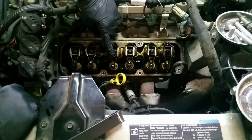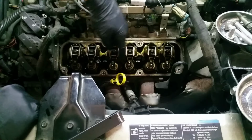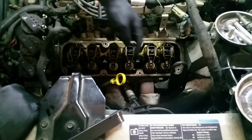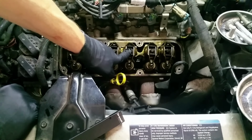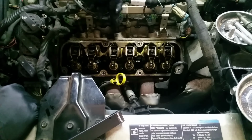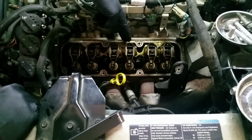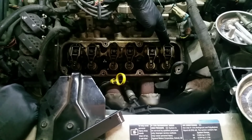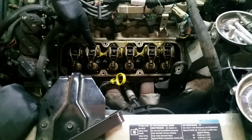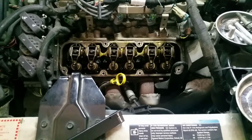The other thing is, I know this is the exhaust side because the exhaust manifold is right here, and it's in line with this spring. And same with this guy over here, he's in line with that one, and in line with that one. The intake side, you can also look at, this is the injector. He's kind of angled in this direction because he's angling towards this rocker arm, and same with this guy, he's angling over here, and this one over here. And again, exhausts are in line with the exhaust manifold, so that's how we know which ones are which.